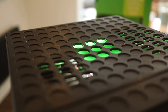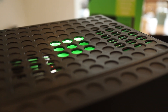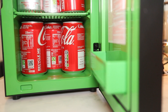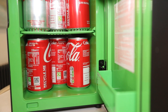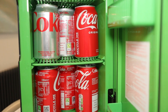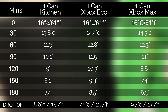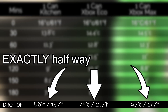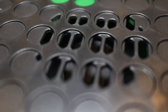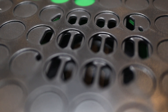We also did the test with a full fridge for each mode, which took considerably longer — around three times longer to cool down to the same temperature — but once it reached running speed there was no change in cost or temperature. The home fridge sat in between eco and max mode. In eco mode the fan on top of the fridge is barely audible, while on max mode you can certainly hear it whirring, so if you're concerned about noise you could just leave it on eco.